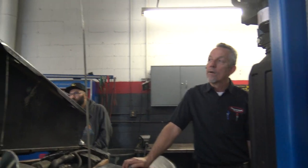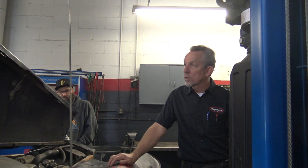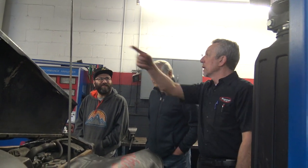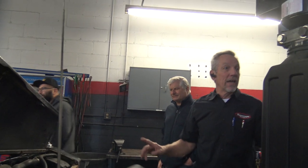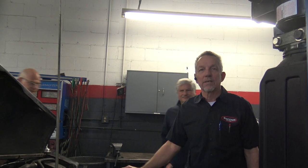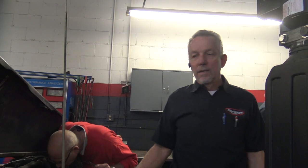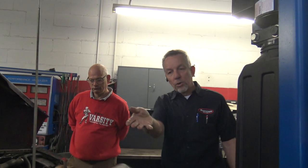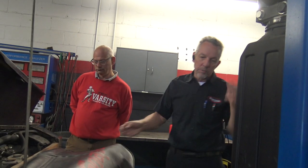What's the plan for this one, Ronnie? Get it running. Make it roadworthy. Get rid of all that old gas. That's the first thing I did — drain it. You can smell it, right? I had two cars — that blue Bentley and this one. Both had rancid gas in them and I had to drain it. It turns everything to like glue. The fuel pump didn't work on this, so I've got parts coming for that.